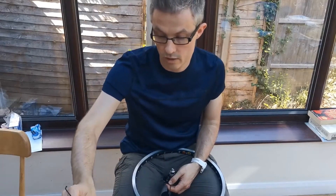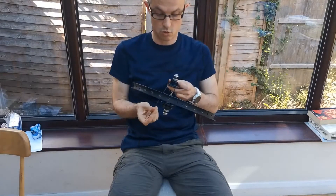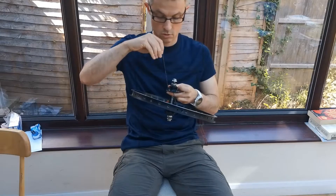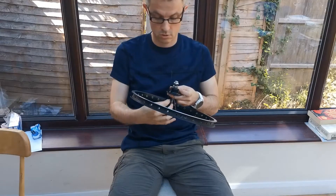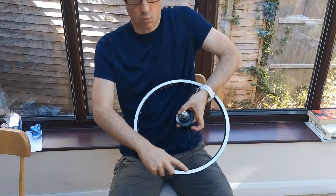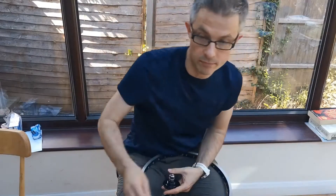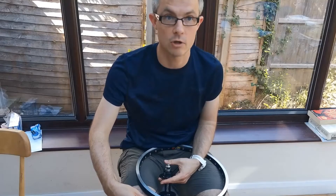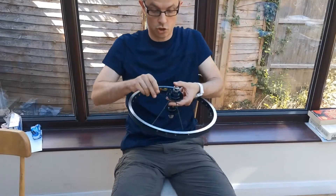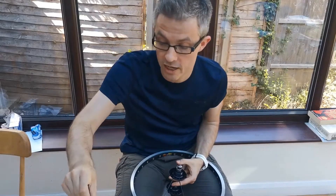And again, on we go with seven spokes. You miss a single spoke hole on the hub and three holes on the rim — so I've missed a single hole there, and one, two, three on the rim, and then it goes here. This time I'm going to be hoping to build the wheel to cross two, which is to say that each of the spokes is going to cross two of the others as it goes into the rim. Never done it before — we're learning together, we'll give it a go.